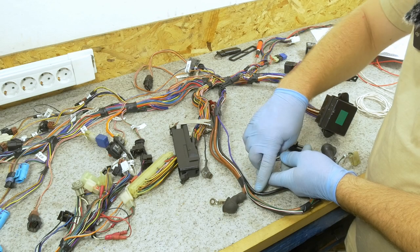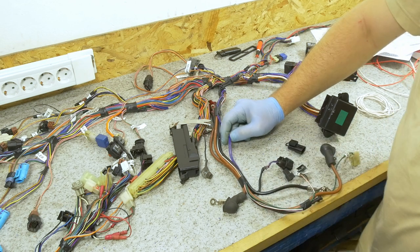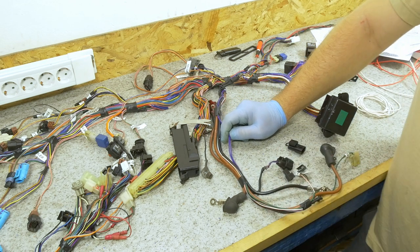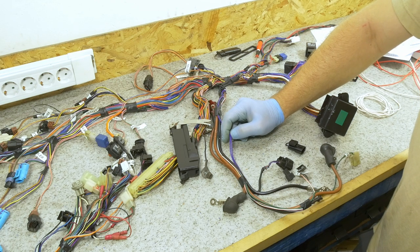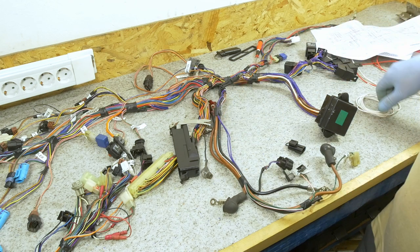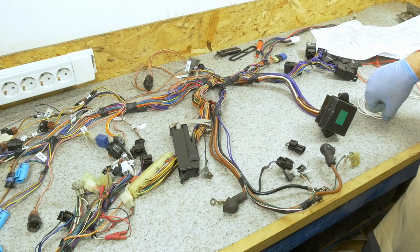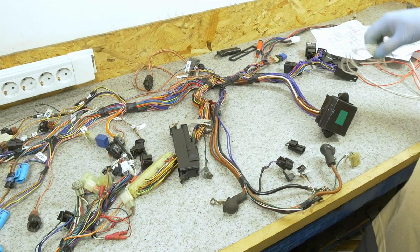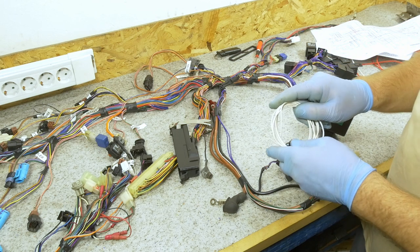Now that we've decided to only replace this short section of the wire, how do we go about it? Well, when replacing wires, you need to know the size, gauge or cross-section area, and decide the method to use. It's also important to know what kind of wire to use. Stay away from any household wiring in your vehicles. It's not meant for this kind of application. And get the right automotive grade materials. More on this in the description below.